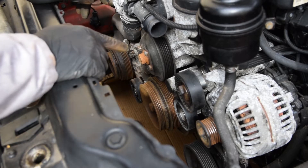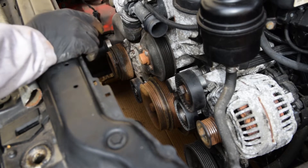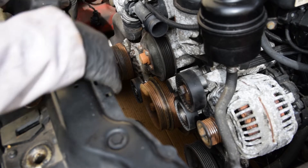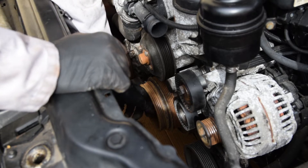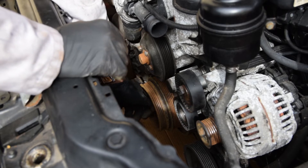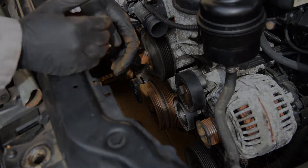We're not going to turn the crank yet. I'm going to put the drain plug back into the oil pan, pour the oil back in, and then see if I can turn the crank and get it to budge a bit. If it budges, I'll know nothing inside is seized — that's really one of my greatest concerns because there were some pipes that were open and not sealed.